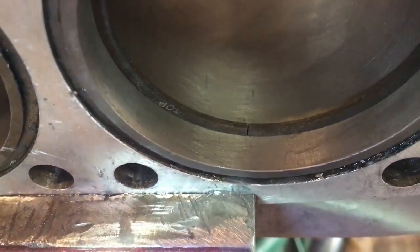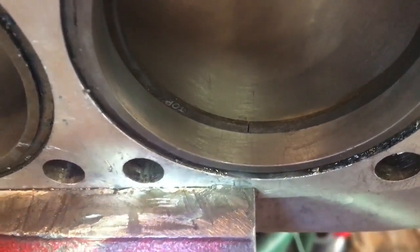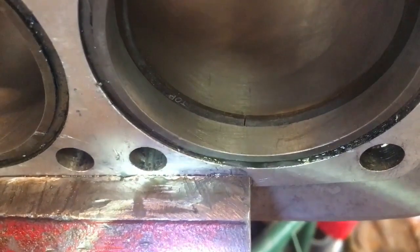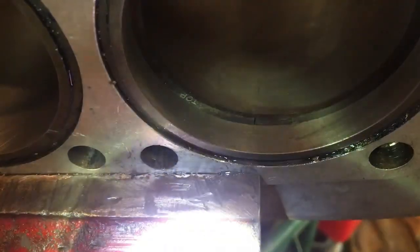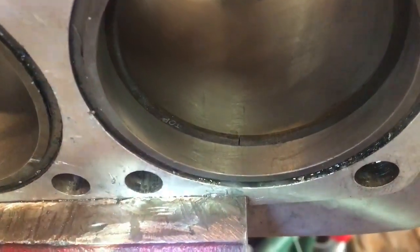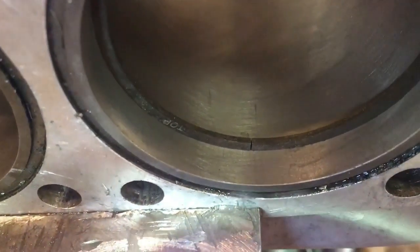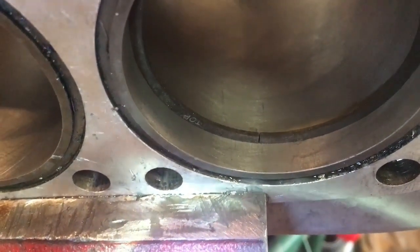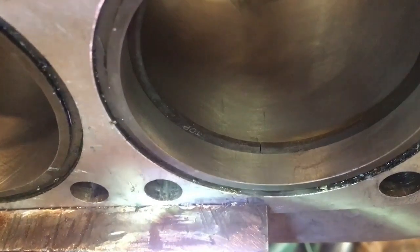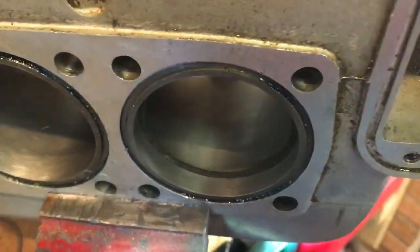Okay, we've been going at this for several minutes now. Plenty of lubrication. It's definitely taking metal off. The bore has gone out about 2 thou, and we've now got, as you can see there, hopefully, a ring gap of about 6 thou there. So I'm just going to do this a little more, and we'll call it at that, ready for a test fit.